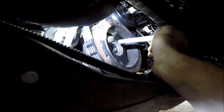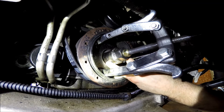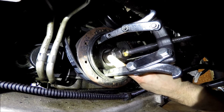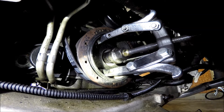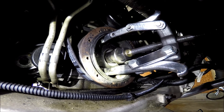That is a seriously huge bolt. I've been out here for literally 30 minutes trying to get this set up. What I ended up having to do was find a socket that was the right depth and also fit, then thread a nut onto the puller — spent 10 minutes finding a nut that fit so I didn't strip out the threads of the bearing system for the install tool. Now everything rotates and it's pulling the pulley off. Before, it was getting stuck on that bolt and I couldn't spin it because it was just grinding into the bolt.